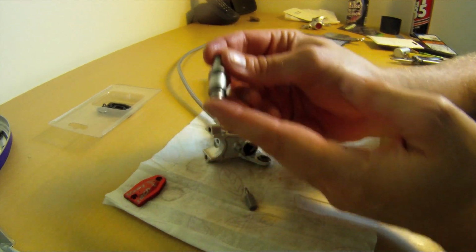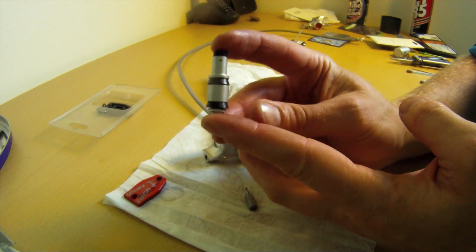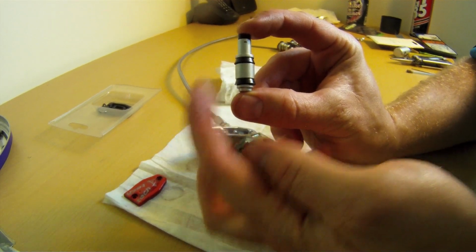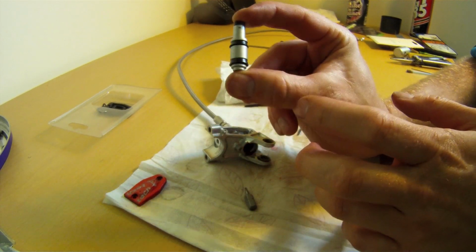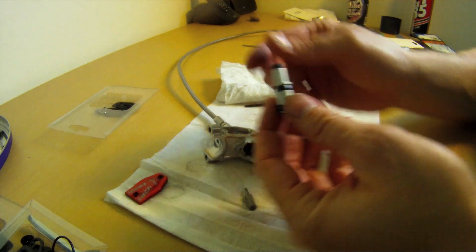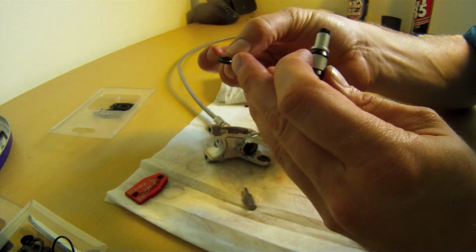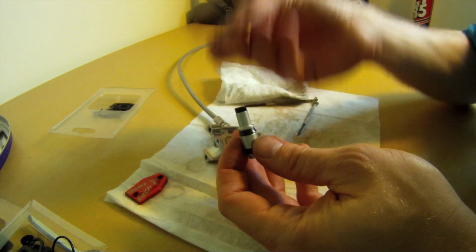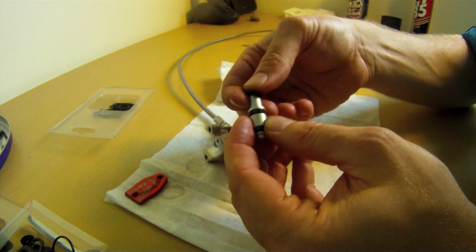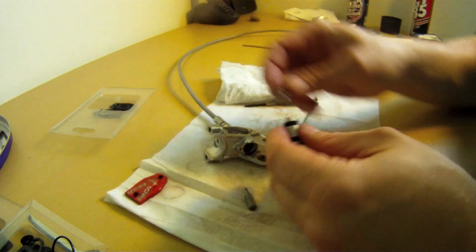So there we go. It's a little plunger assembly with some nice fresh new seals on there. See how those seals flare out towards the bottom? That's what you want, flaring out there, so it can actually do a job of pushing the fluid down the master cylinder assembly. Finally, you just need the little outer dust cap seal, so make sure you put that on with the little dust catching lips facing the outside. Don't do it the other way around, as it won't seat properly. Just pop that on, and she's ready to basically reassemble.